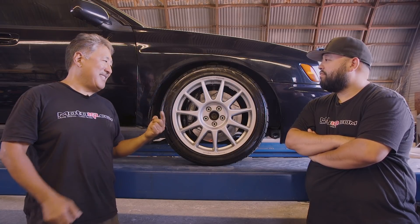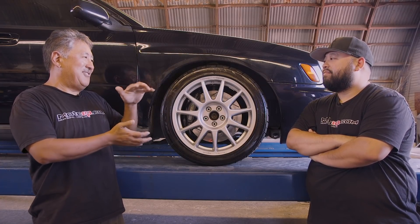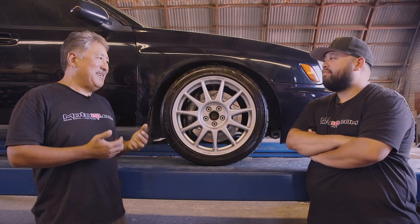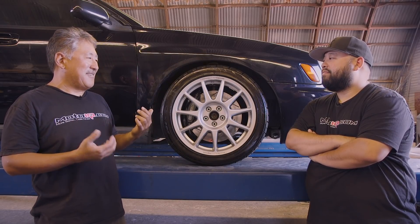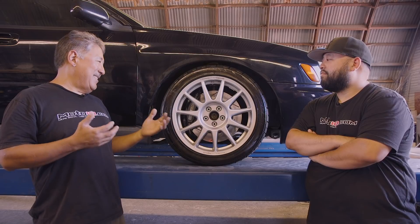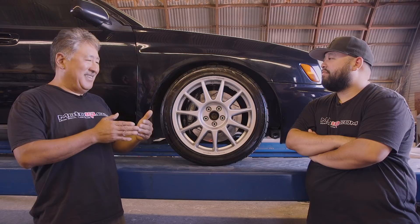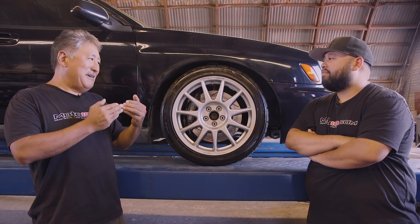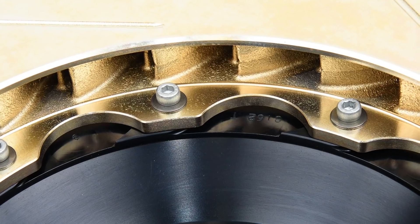The float is a pretty cool thing. One nice trick StopTech uses is — if your rotor is floating, it would rattle and make a chinging noise when driving on the street, and for a street car that can be really annoying. So StopTech uses a conical Inconel washer that puts some spring tension on the friction ring so it doesn't freely rattle back and forth.